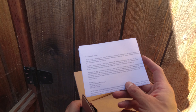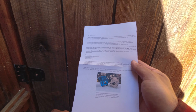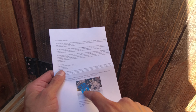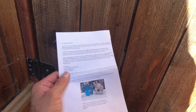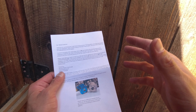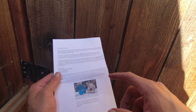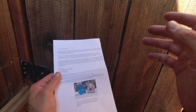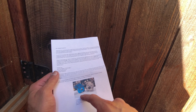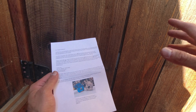A little notification on behalf of Trask: if you have a 2019 or later model, you're missing this O-ring right here. This is something Harley has been adjusting since 2017 — they've been messing around with the oil pump. If you have a 2019 or later model, you may get excessive venting — a little more oil coming out. Just a heads up: you still have to replace the oil pump.